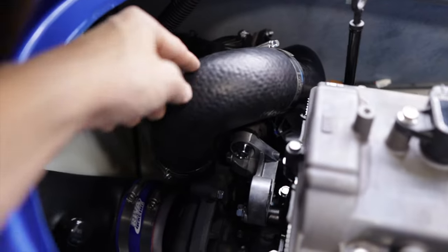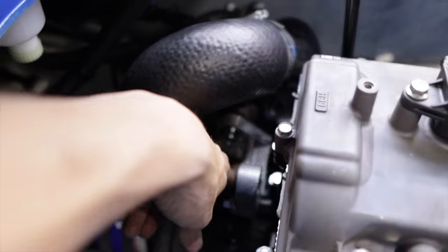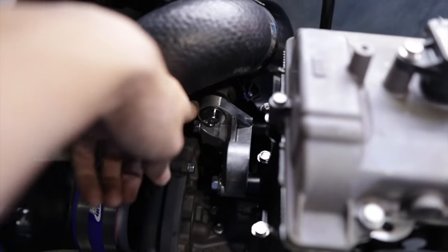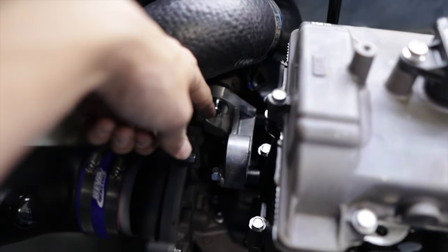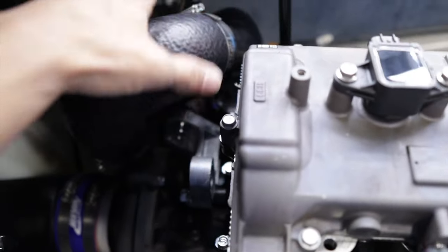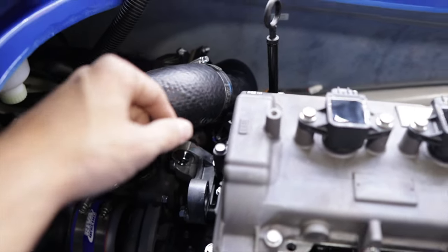When we're taking off the intercooler, we're going to start with taking this boost hose off first. That'll get us some room to get all these bolts out holding in the intercooler itself. Once we get these out, this bracket will come off, and then down at the bottom there will also be another nut holding on the intercooler. We can do away with all of this because we'll be swapping over to the Riva intercooler.